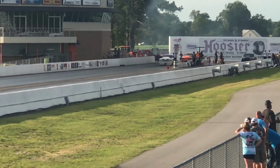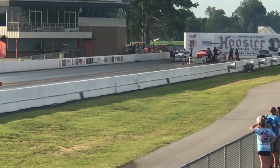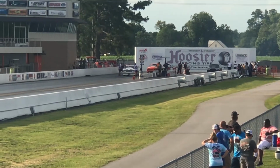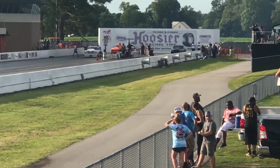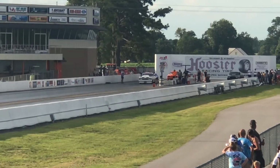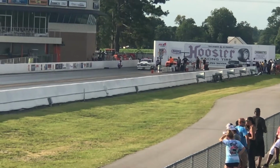So with the small tires and the shock settings and air pressure that we had initially, the car just blew off the tires at the hit. So we went back to the pits, met up with Turbo John. He looked at the tune-up. We changed the shock settings, a little air pressure on the tire, made an adjustment on the tune-up, and you'll see the results of that in the next video.